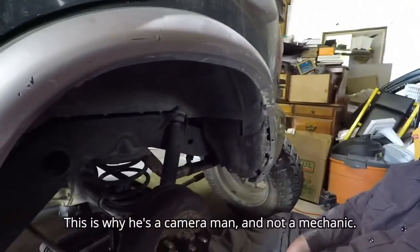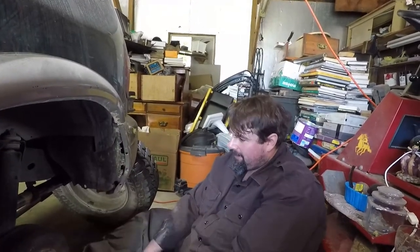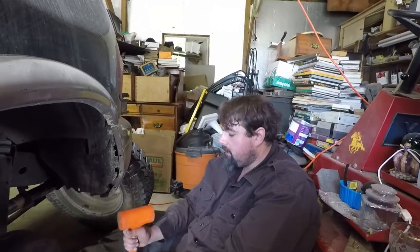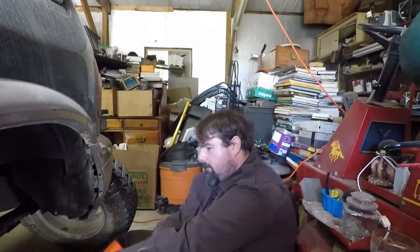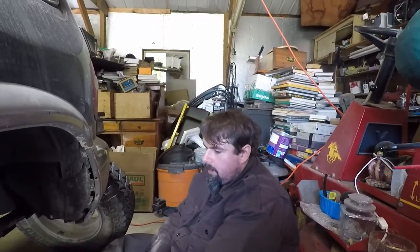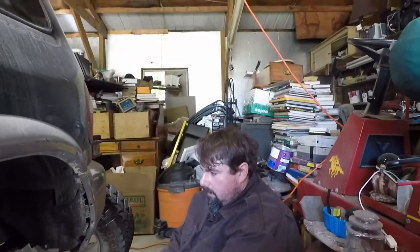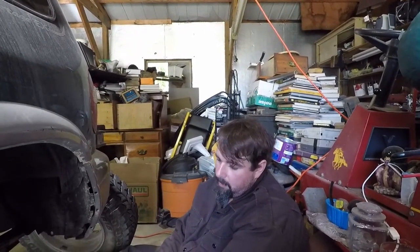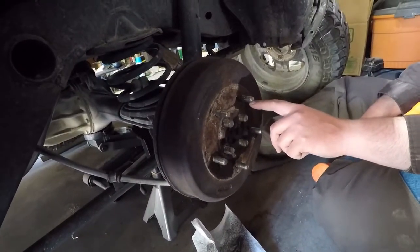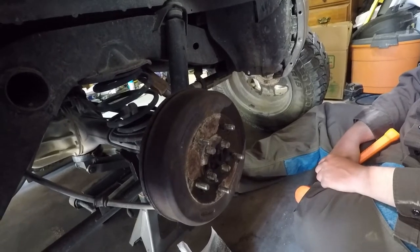Hear me out — you have four wheels, technically you only need three. If you take that wheel on the other side and slide it into the middle you get a three-wheeler. The problem with that is I've already got three-wheel drive with an open rear diff — so when this thing locks down that wheel just loses all traction, which is aggravating on loose gravel. You end up having four-wheel drive when you really don't need it.